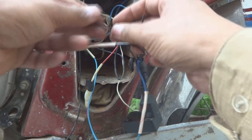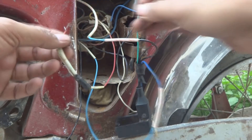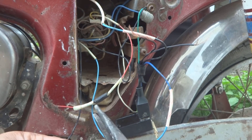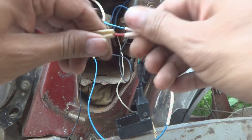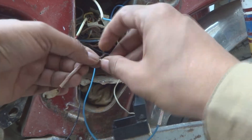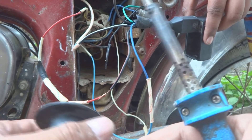Now is the time to fix these two wires — black with yellow going to the ignition coil, and this red wire, black with red, it will be connected over here. But first we will put the sleeve on. The sleeve we will put it on the black with red wire — it will be connected over here and we will solder it, of course, because this is taking power from the CDI, so it should be soldered.